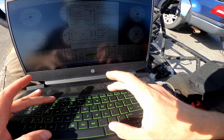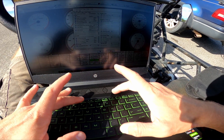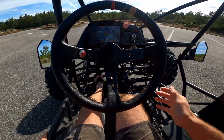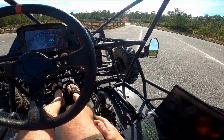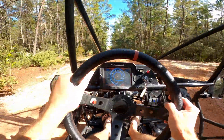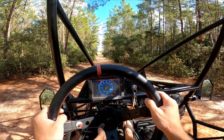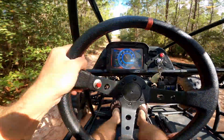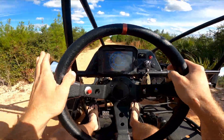Launch set to 4,400 — nice, mild launch. And we're going to set this to 4,700, just to kind of test it out — mild. Let's make sure our switch is working. Launch control — that is so easy, that is so cool. You put the clutch in and you're already in launch mode. First to second shift — got to stay on the throttle. This is so tricky. My brain is just malfunctioning trying to figure this out. It's so hard to stay on the throttle. First to second. You heard that crackle — so it's limited the throttle. We know it's working.